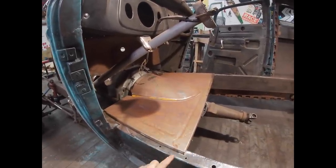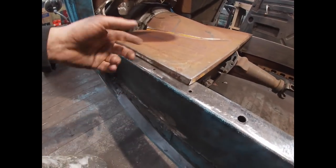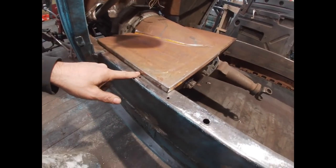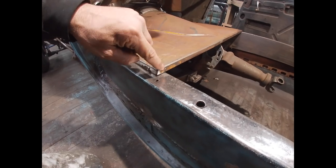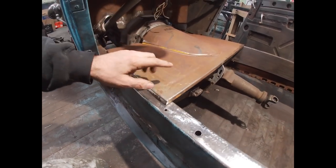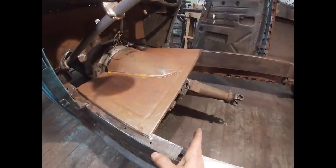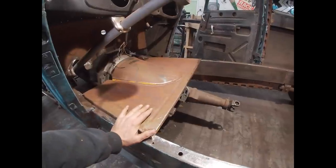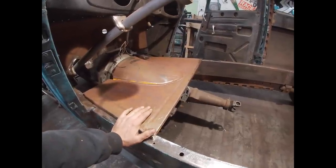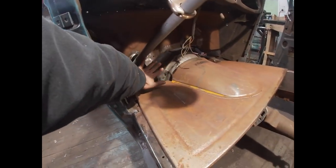and the thing just fits perfectly. So what I'm going to do is I got to bend these where it's bent over. I'm gonna bend these back out, flatten this back out. I'm gonna leave this one notched, lip down, but I just need to notch it here. I may end up having a little strip of metal here in front of the seat, but for now, I'm gonna use this panel so I can get this set up, and then I can start working on my toe board.